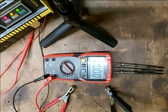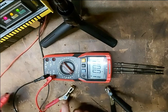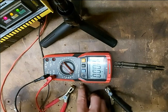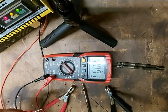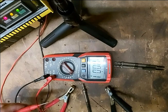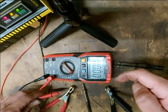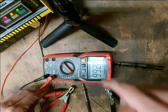Before you put them in - if you tested them this way - then if this is your cable to the top of your glow plugs, try them. If you make contact with your key, the voltage should be jumping up. If not, then your relay is defective.